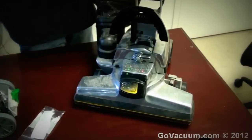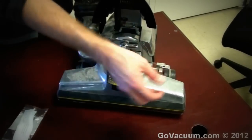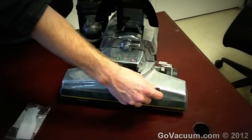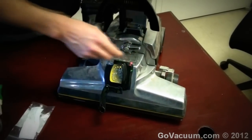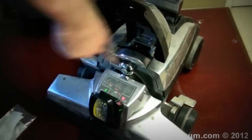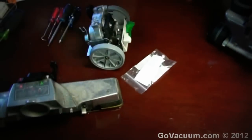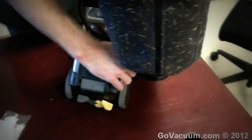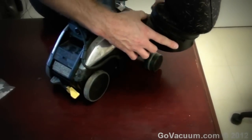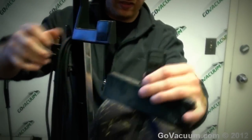Let's get started. Take the lens hood cover and lift up on it. Just like we're changing a belt, we pop out the arm if it's on our model and then twist it up, taking the belt into the off position. Then we take the latch here to remove the nozzle. Now I'm going to spin this around, take off the outer bag — push away from the vacuum cleaner like that, which releases it from the base. Then hit this clip and that releases it.